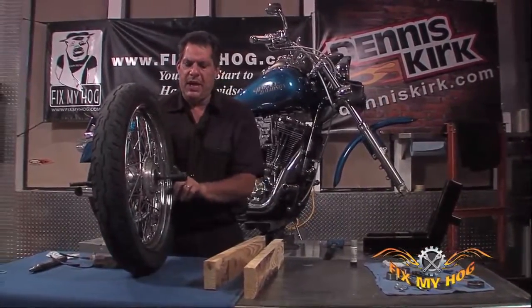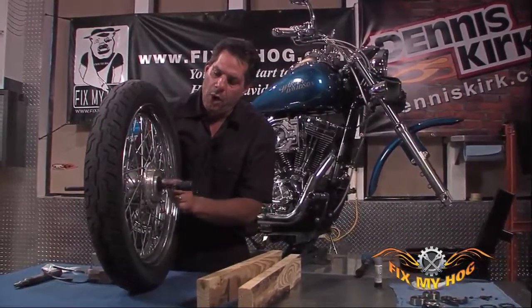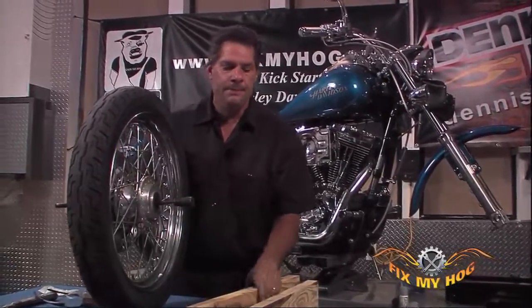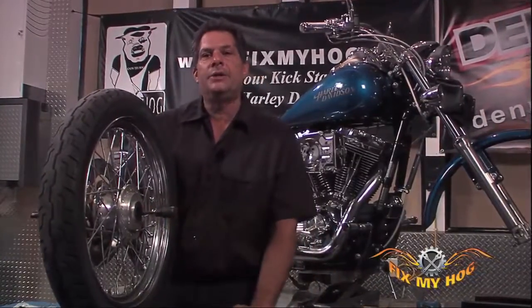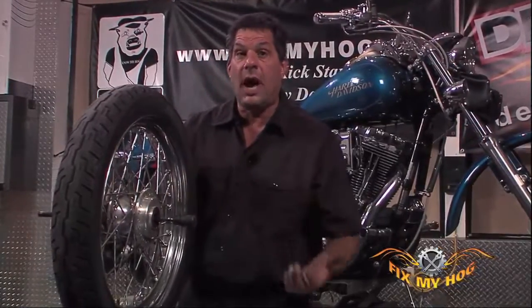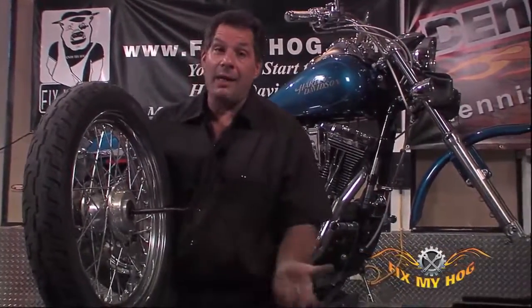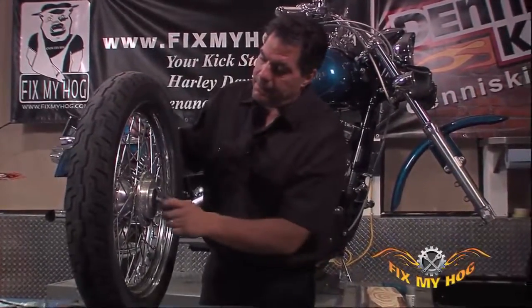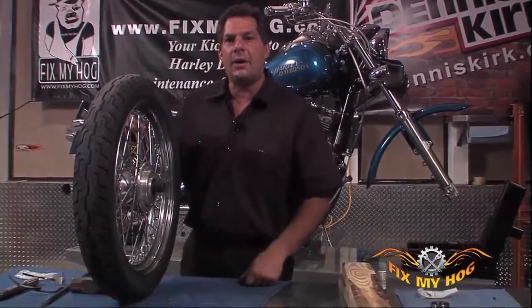At that point, you can see the puller tool released from the inner race before it grabbed the inner race and removed the bearing from the hub. When that happens, it typically tells you the bearing is frozen in the hub. It may be more difficult than just driving it out. So what you want to do is remove the collet or the driver piece of the tool. I like to put it back into the inner race and put the wheel assembly on the concrete floor.